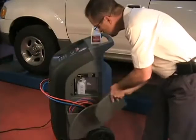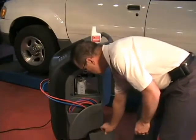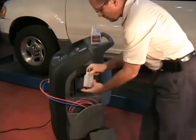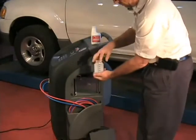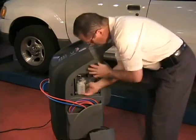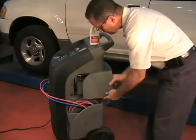To fill the oil bottle, remove the right panel to expose the bottle. Release the bottle quick disconnect fitting and remove the bottle. When using PAG oil, add oil just before vehicle service. You are now ready to use your CCST-288.